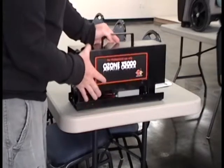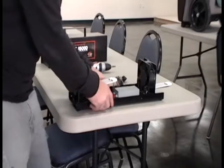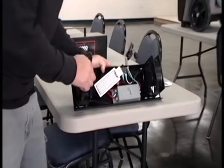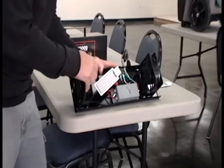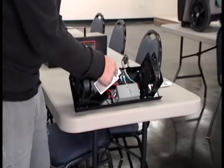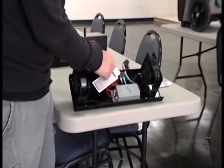I'm going to remove the case. As you can see, we have the transformer and the ozone plate that's here. On the actual production model that we'll be sitting out in the field, we'll have a small bead of glue that's here. So the first thing you want to do is either take a flathead screwdriver or even a razor knife — just be careful not to cut your finger — and remove that glue.